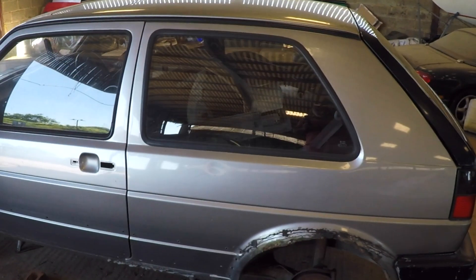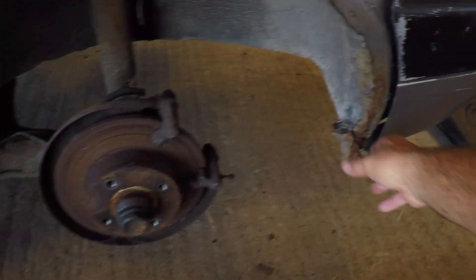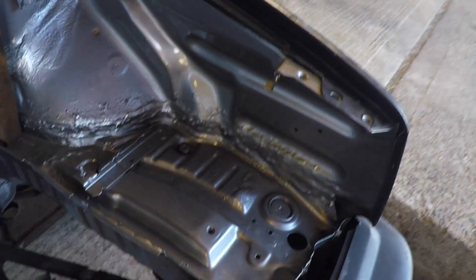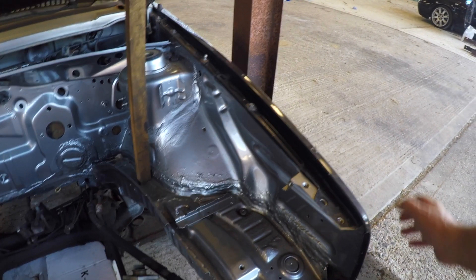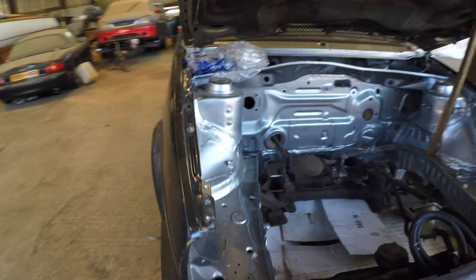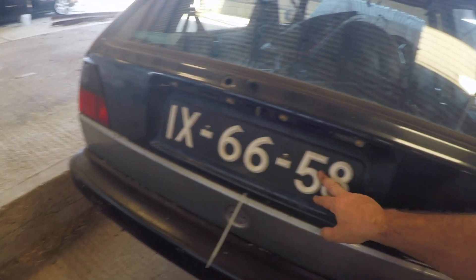It's been sitting here for a while, but we've finished a few other projects and now we're going to press on with this. The first job is repairing these rear arches. The sills aren't too bad, the jacking point isn't too bad, but the front chassis leg where the battery tray was is really bad. Luckily we got spares from Portugal — dry climate — so we actually cut the chassis leg and took off what we needed, giving us a rust-free panel. These wings also came from Portugal at the same time, rust-free, because the originals were quite bad.